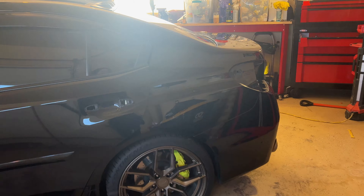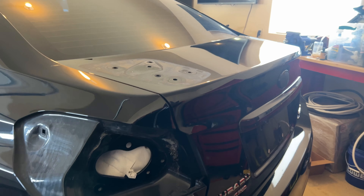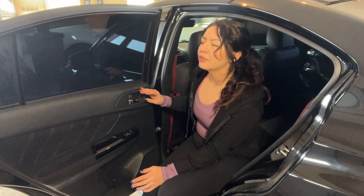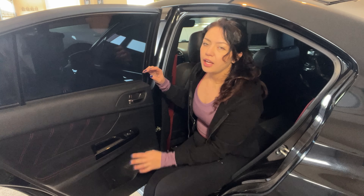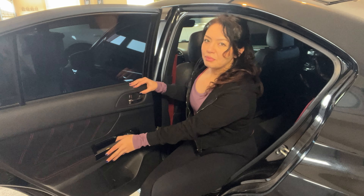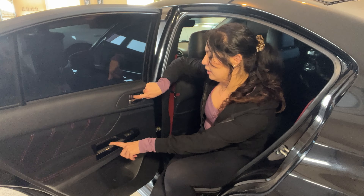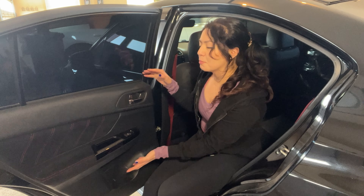With the spoiler off, it looks like I have a WRX — like I cut my car's wing off. Now we're going to work on removing the door handles. To access those we have to remove the whole door panel, but it's not too bad — just two clips that pop out with a flat head and then two screws to remove, and then I can pop it off.